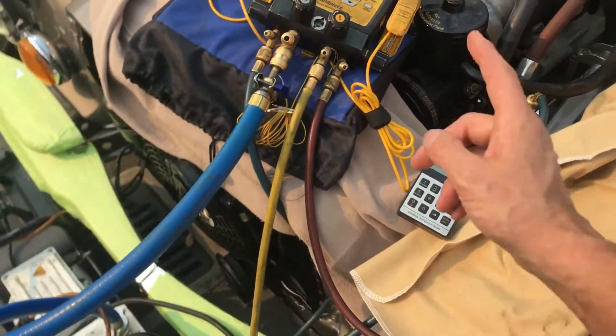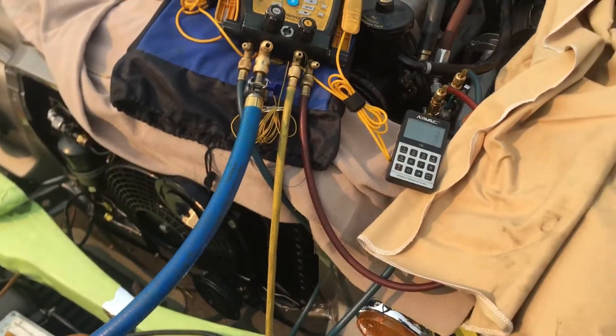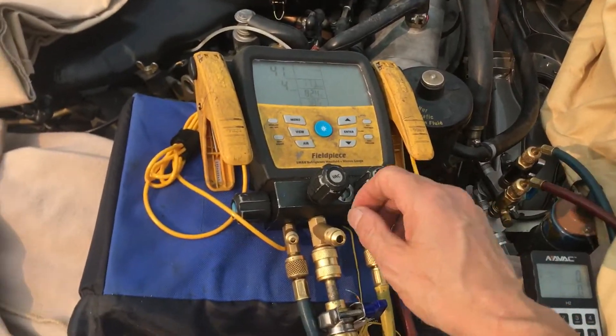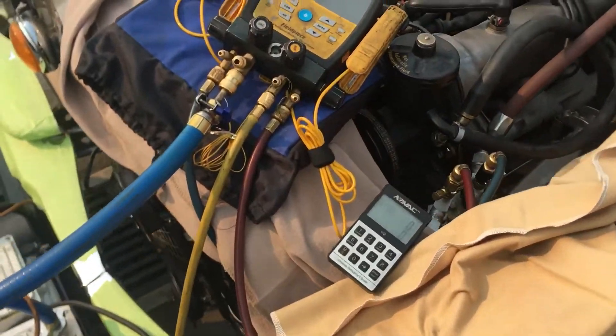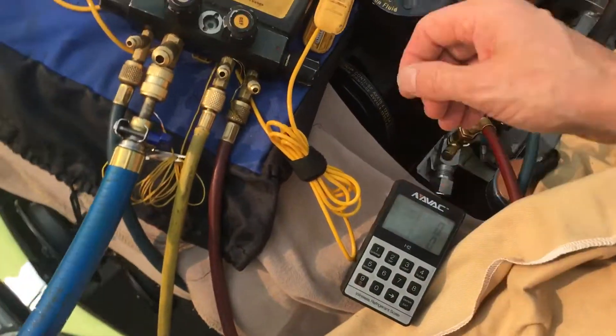It's pretty good. If you get it down to 39 or 40 microns, you're doing okay — especially on a car with rubber hoses and rubber seals, even with the vacuum pump on and everything like that. You got it down that good, you're good to go. It'll bounce back up to 100, 200, 300, but you're pretty good. So, 800 microns — let's get this inside.